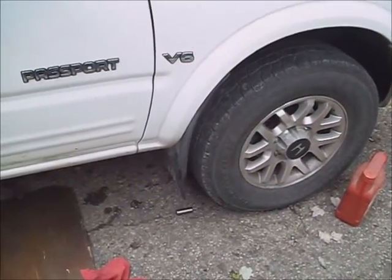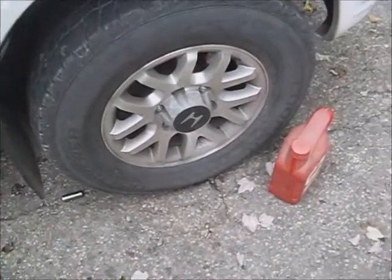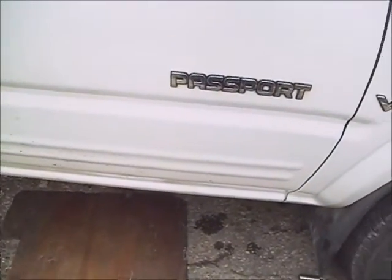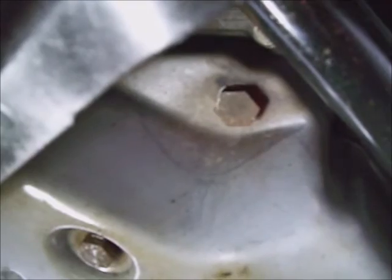I'll check the fluid level through this screw here and add fluid through there. On the transmission pan there are two plugs — the lowest one is to drain the transmission pan and the upper one is to set the level with. This upper one shouldn't be taken loose without the vehicle running, or excess fluid will run out.